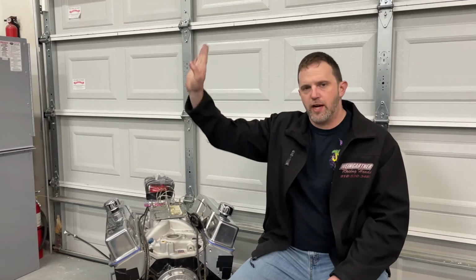And they say Superflow doesn't recommend that because it doesn't have as much control on the engine, and that's why it's trying to flip it up there. Which, by the way, didn't make that much of a difference anyway, because the peak power, I think, occurred at like 58 or 6,000 RPM. So we're past that anyway, so it makes no difference. So anyway, at this point, we start doing another backup pull just to make sure everything's fine. Here's, I think, one of those pulls.